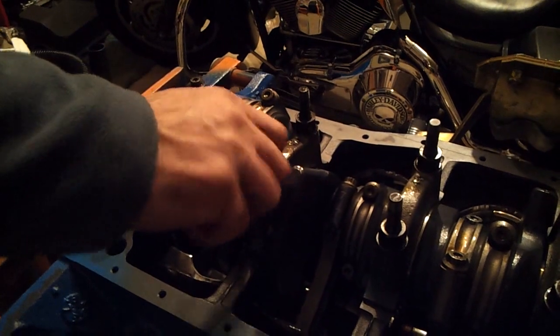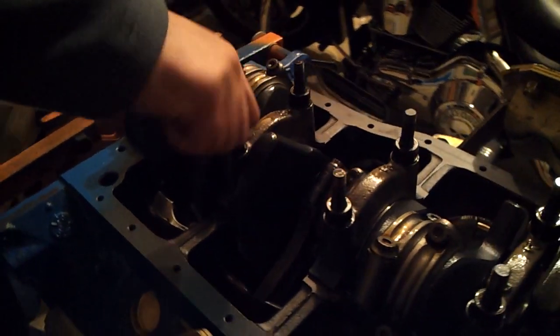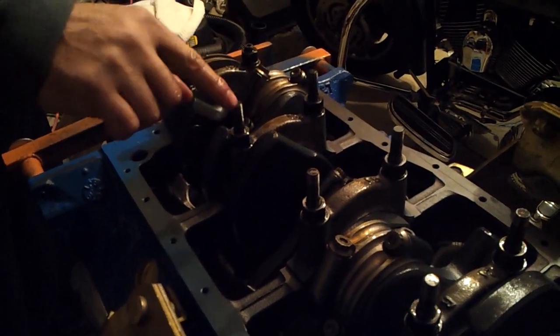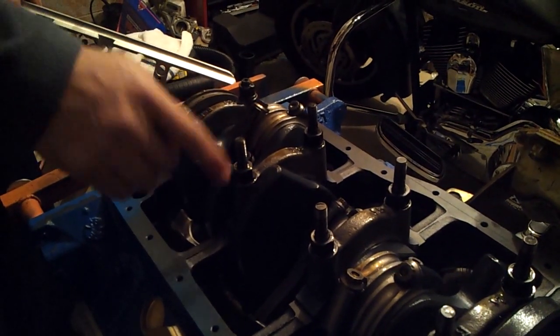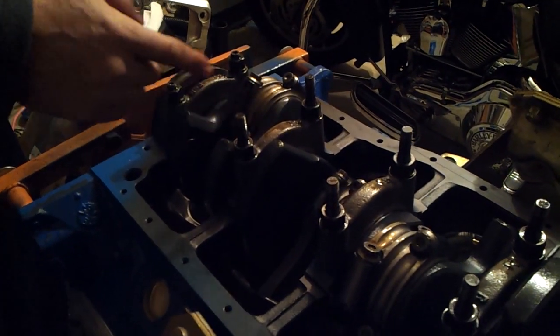That's all you really need. You could actually grab the stud and back it out by hand. So again, if you're not familiar with using studs instead of bolts, when you put the stud in place, just make sure it's finger tight, and then put the nut over it. Make sure you've got the appropriate lubricant that's needed, and make sure that the threads on your studs are clean.